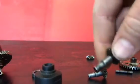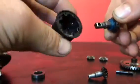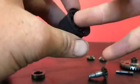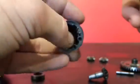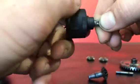This is the midpoint of the video. The other half covers the second diff. If you're confident after the first one, you're good. If not, the second half is for people who didn't quite get it. Right now I'm going to show you how to put the seals on — two blue seals on that gear going through the middle of the black casing, not one on each side like the other diff. You slide it right through the middle. That was the part I was missing. After this, I'll keep the video silent so you can learn on your own.